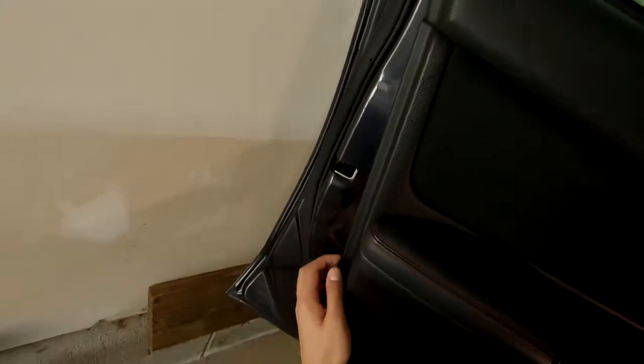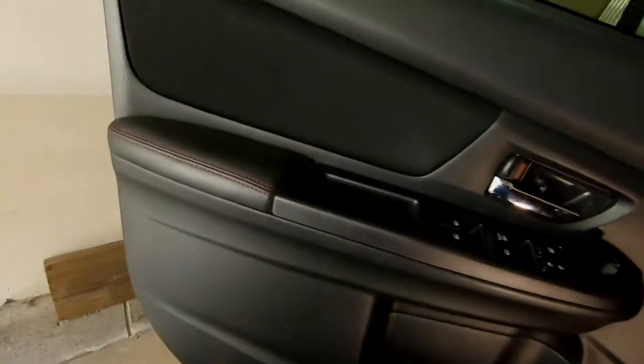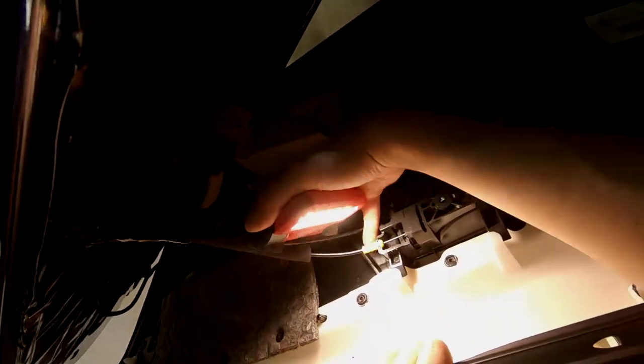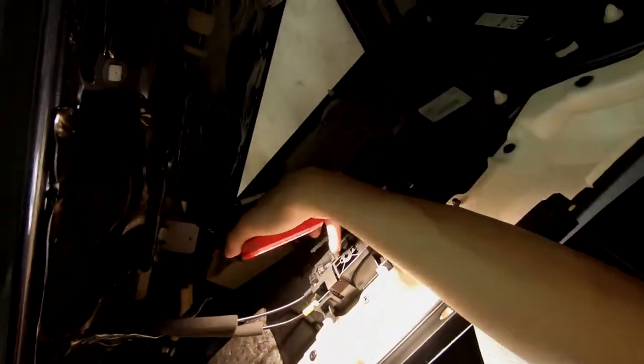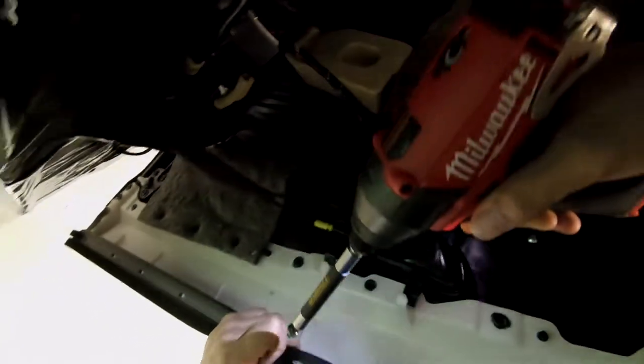I like to take off the door panel from the inside. If you gouge it in there, nobody's gonna see it. Door panel is off. Next take off the door handle assembly — there are two screws. I find it easier to take off the whole assembly so the ball doesn't have to be rehooked. Door handle comes right out.